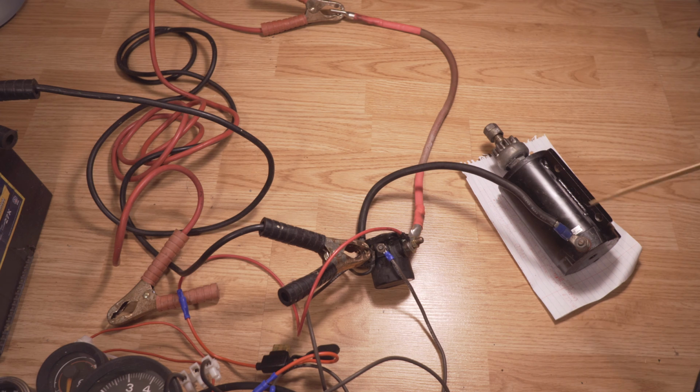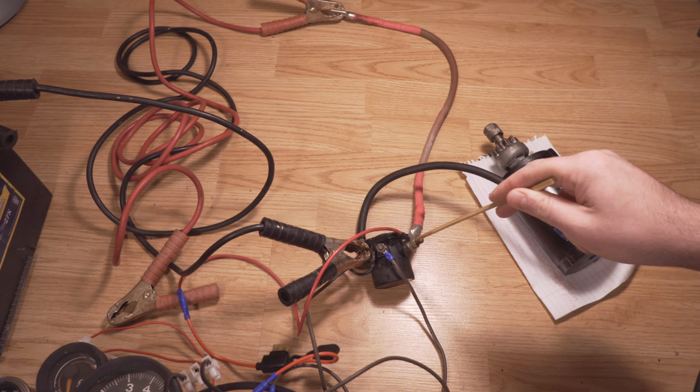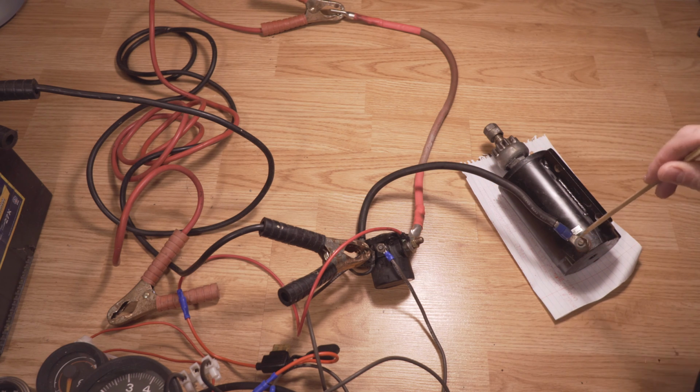So it's really very critical that the cable that goes to the battery, which obviously provides power to the engine itself, the ground, and the cable that goes from the solenoid to the starter have great connections and are basically in good shape. This is very, very important. You can literally look over everything else and it could just be a simple cable connection issue. Like I said, it really might not be apparent at first because often the rust or corrosion will be under the plastic cover or under the little rubbery cover area on any one of the sides.